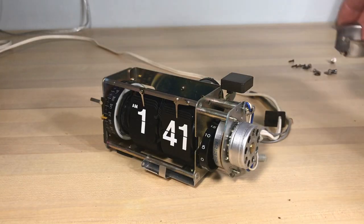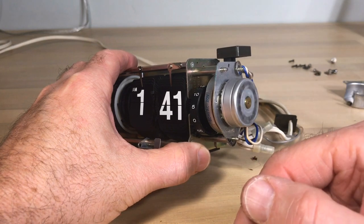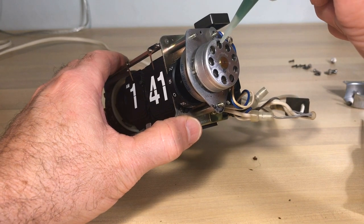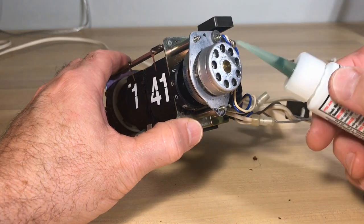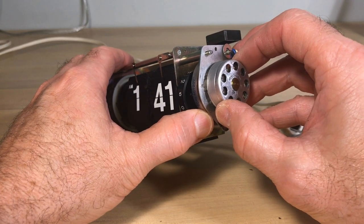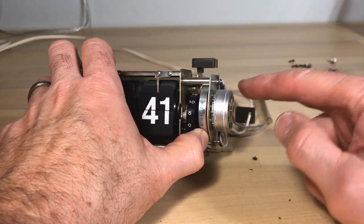I've removed the can here so I can get access to the motor. I've already put some oil in there off camera, and I'm going to do that a couple more times to get a proper amount of oil down in there. What you do is get the hole right above the arbor — right where it spins — and you're dropping the oil down the back side. You don't need any on the outside. I'm doing a little bit of a pulse; you've got to be careful doing that. It helps get the oil in there, but you don't want to pull the gear on the other side off.